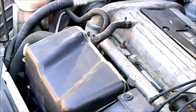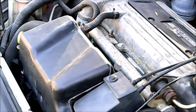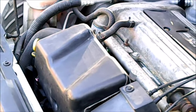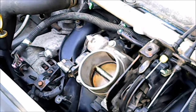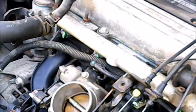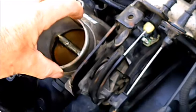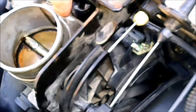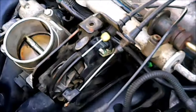So, not to bore you in that process, we'll be back to give you an idea on how to remove that airbox. There is also a clamp which mounts to the air intake on the throttle body. You've got to reach in with a screwdriver into this hole right here to get to the clamp, then disconnect your PCV and other connections.